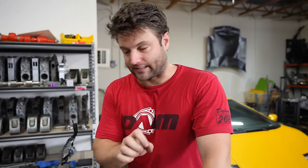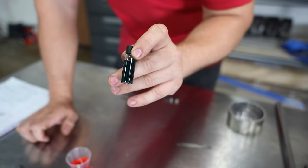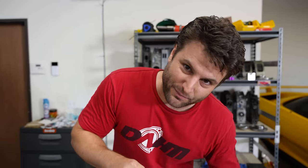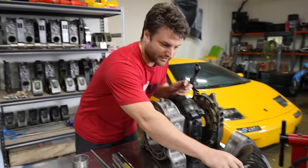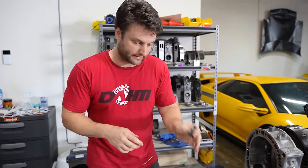The second major solution is pre-mixing. This is Valvoline's VR1 20-50 full synthetic oil. Everything that makes this oil amazing at what it does is everything that makes it bad for a rotary engine. This oil is meant to sit in that beautiful oil pan and lubricate the bearings, the E shaft, the gears on the sides of these rotors. It is arguably the absolute best stuff for rotary engines — but there's an inherent flaw to rotary engines that makes it the engine's worst nightmare.